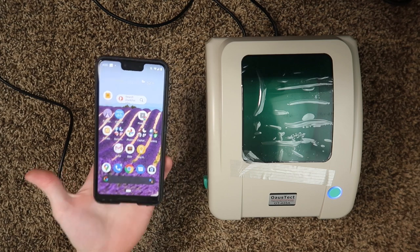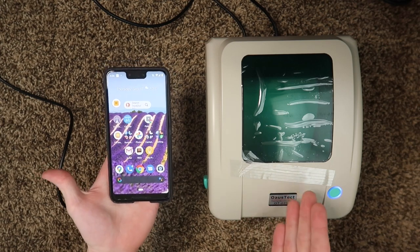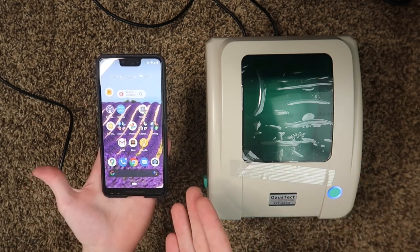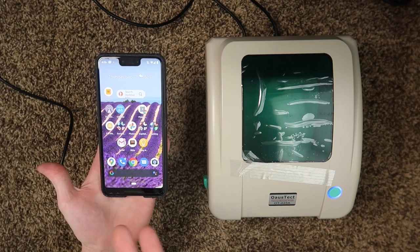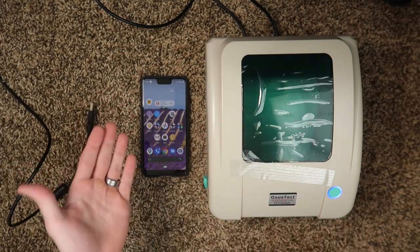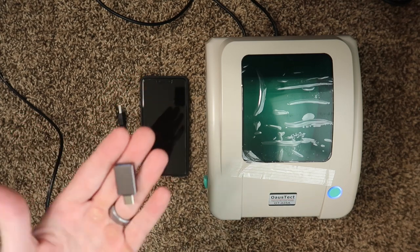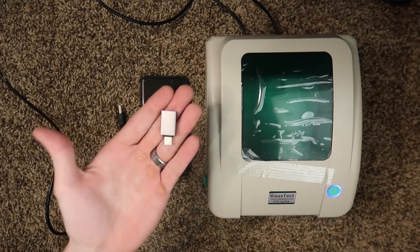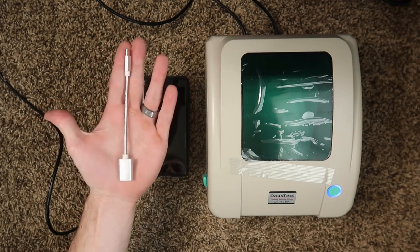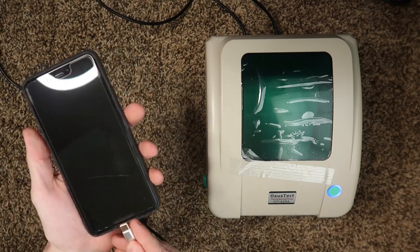Using this printer on Android devices is something the companies don't even know is possible — it's something I figured out earlier this year. It's a great feature if you're running off your phone, because you can print any label you can pull up on your phone. To do this, you need that USB cable and a USB to USB-C converter or a dongle like this. This specific printer came with a converter, but you can also purchase one off Amazon — I'll put a link in the description. Take that USB cable, plug it into the dongle, and then plug it into your phone.